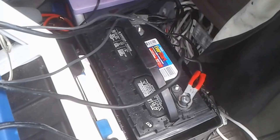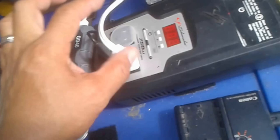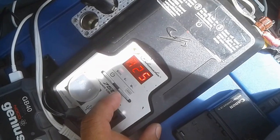I've hooked up the positive to the positive — red to red — and negative to negative, and the system should be up. Let's take a look and see how much voltage we have. My inverter tells me how much power. It says we're pulling power for the rice cooker, which I've unplugged, so now we're back to zero. It says 12.5, so the battery's not fully full. Usually when these 12 volt batteries are full, they say like 12.8 or so.